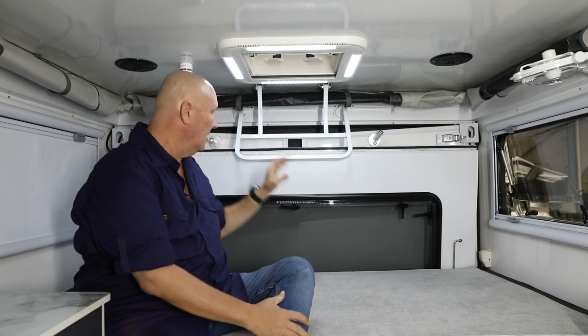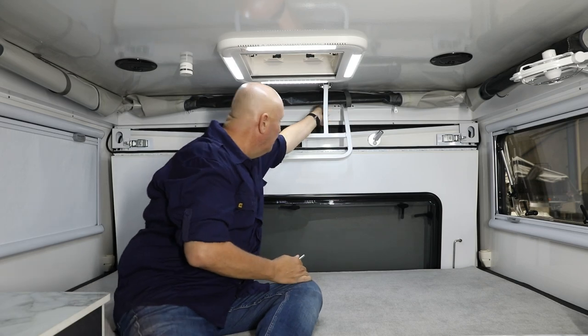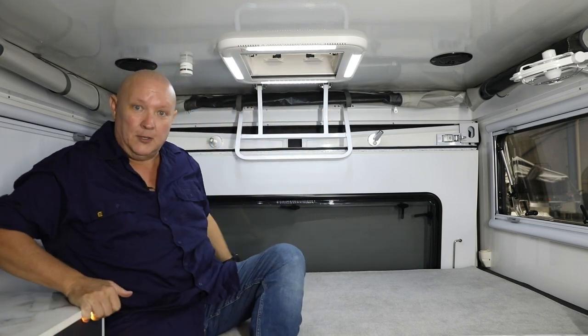When you're lifting up the pop top lid on your Parks, I find it easiest to start at the back and then work your way forwards. It's the same deal when you're packing it up — start at the back and then work your way towards the front. The first step is to remove the locking pins. Take these out — excuse my back, but it's a two-handed job.